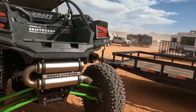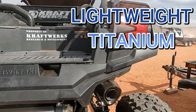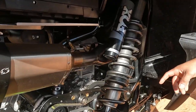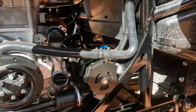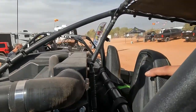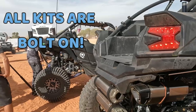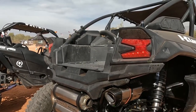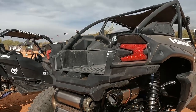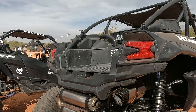The KRX — this looks nice. So this is our dual exhaust that we're going to be releasing for most vehicles. It's made out of titanium — really nice setup, super light, you save a lot of weight. This one's supercharged as well with the same C15 Rotrex head unit. We have it on iBoost too. The C15 setup has its own cooling and oiling system for the supercharger so you don't tap into the motor. All of our kits are bolt-on — no cutting, no welding. We usually say about eight to ten hours to install. We offer base tunes for all our vehicles.